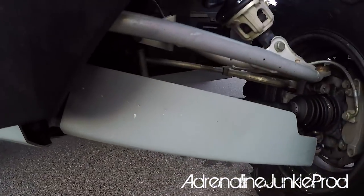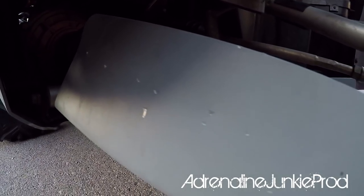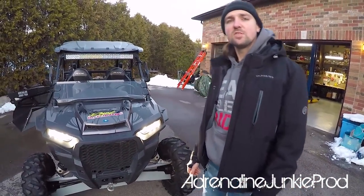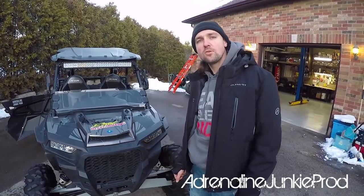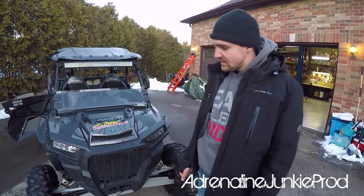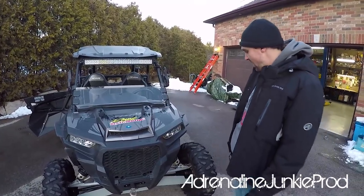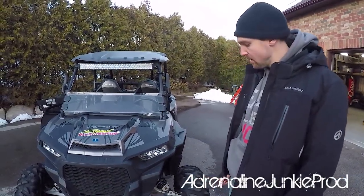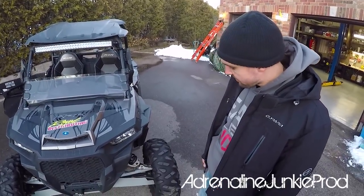We've got a couple little dings in the Rival aluminum skid plates on the A-arm guards. Unfortunately we won't be able to run the A-arm guards anymore because once we upgrade the control arms to the Super ATV unit, they won't be compatible. We'll be putting a set of Super ATV forward-facing heavy duty high clearance front A-arms on this machine. We've also opted to get rid of the ball joints and go to a uniball and stud, so hopefully that will make it even stronger. We've gotten a whole season out of these OEM ball joints and I know there's a little bit of play in at least two of them, but they've held up pretty good.